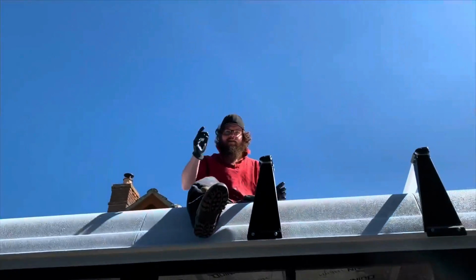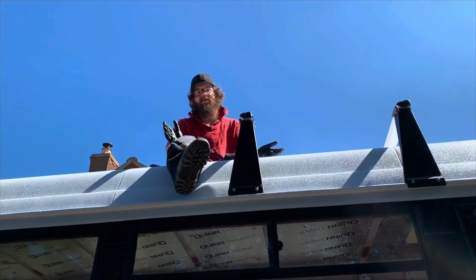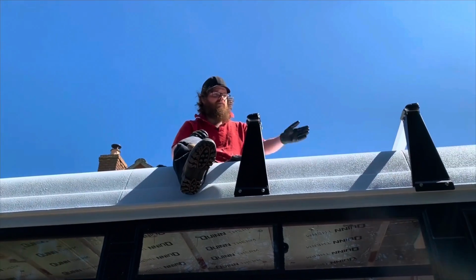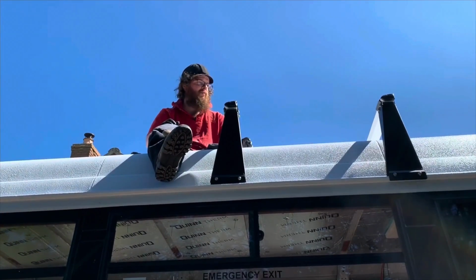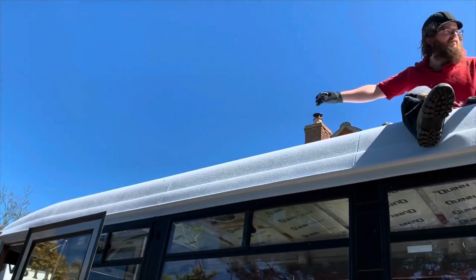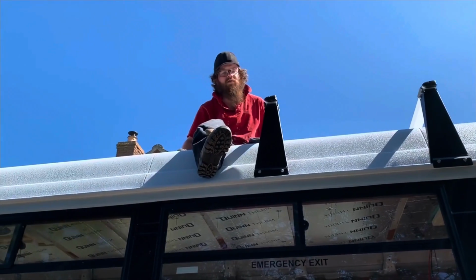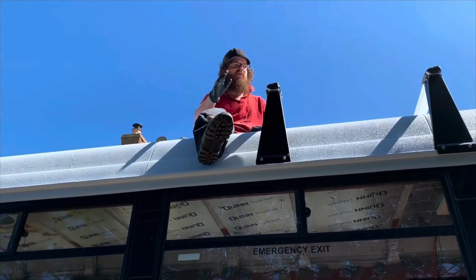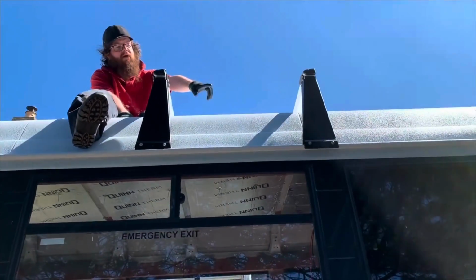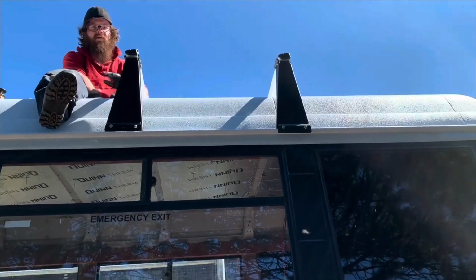Oh, cute. We're going to put these at 1 metre centres because our solar panels are 1 metre wide. They're big. Makes sense. So I'm just going to move it a little bit further. It's only about 70 at the moment. Then we're going to have a third one about here and then 2 at the front. And then in his room we'll have 1 at the back with some other storage goodness. So we're just roughly placing them at the moment. You can see here, this one's not tightened up yet, but they just tighten up and attach to the gutters, so there's no drilling to the roof.